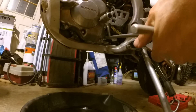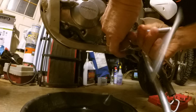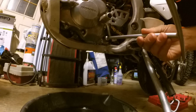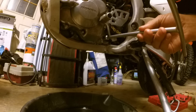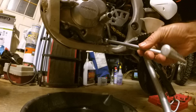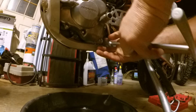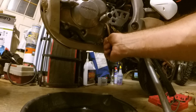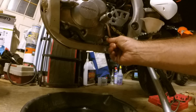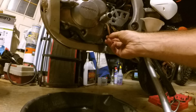It's a long bolt in here. Again, you don't want to over-tighten these. So I just ran the bike for a couple minutes to let it get warm. I'm going to take this out slowly. There's a crush washer behind it also. It's going to get all over your frame — there's really no way to stop that unless you let it drain slow. But as soon as you get this bolt out of the way, it usually comes gushing out. And there it goes all over my frame.